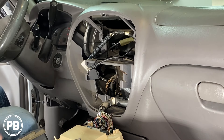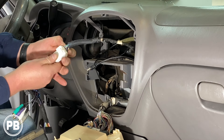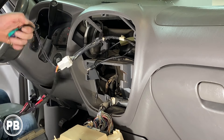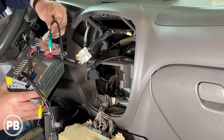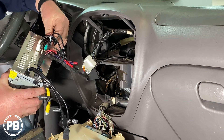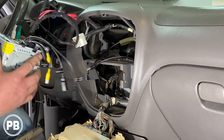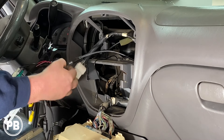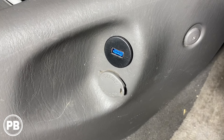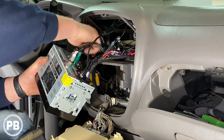We're here back in the dash. The first thing we need to do is get our radio harness plugged into the factory harness. In terms of what RCA goes where on the back of the radio: white is going to be your front left, gray is front right, green is rear left, and purple is rear right. So we hook those into the RCA outputs, make our other various connections. We actually installed a USB connection down below and hooked up the antenna.